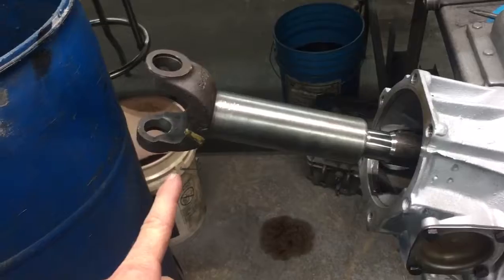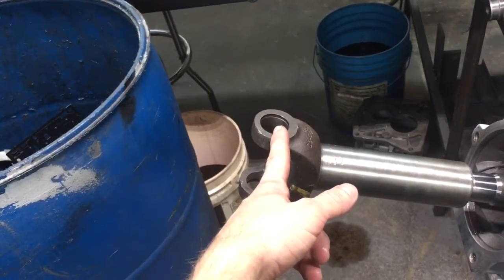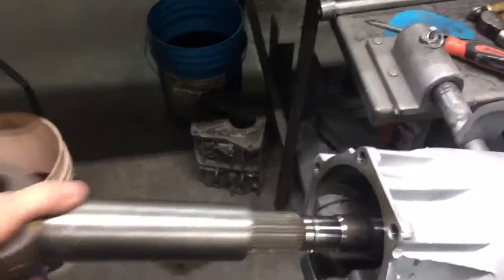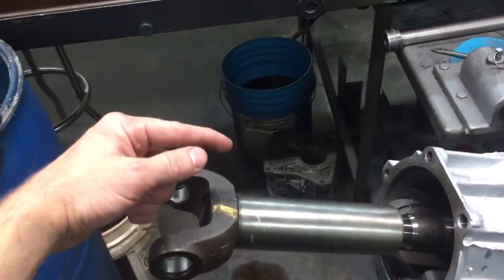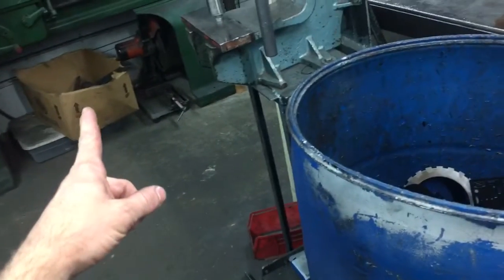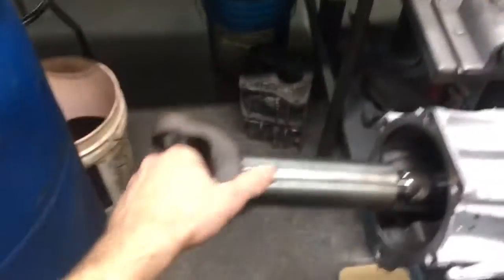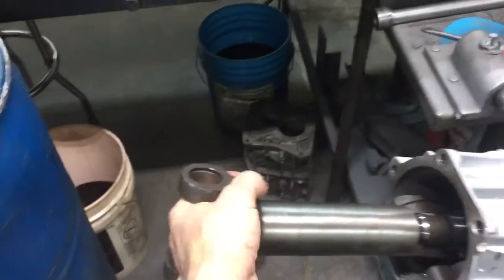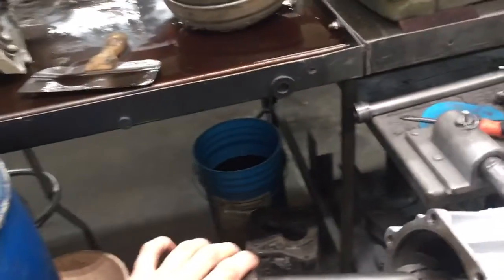What I always suggest is: load the rear suspension all the way, then measure from the middle of the u-joint to the middle of the other u-joint. Get them both parallel to the ground. Don't measure with one u-joint angled differently than the other — you'll get inaccurate measurements, think your driveshaft is bottoming out, and it'll just be because you didn't pair up the u-joints properly when measuring.